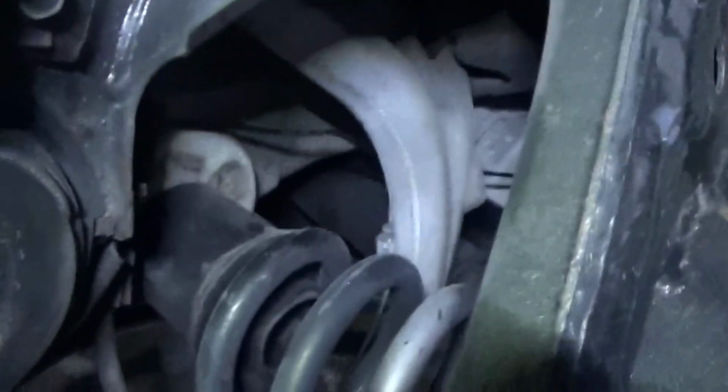So the wire was ran above the suspension here through the bumper, and this is where we placed it. It had to be placed on the bumper support, because any lower we couldn't place it down here because you'd see the LEDs, and we couldn't place it here because of the exhaust, so it had to be tucked up in there, but you still get good visibility.